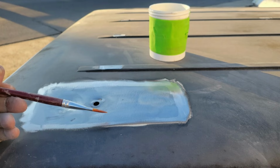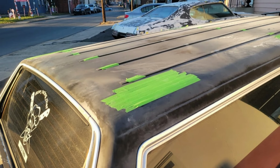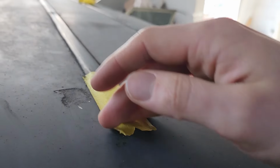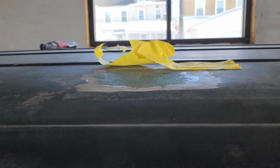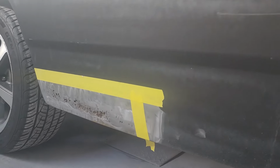Here the metal is getting treated to kill any rust and sealed with a low-tack water-resistant tape to set. Finishing up the metalwork here with a touch of Duraglass. Sanding down the paint to see just how bad the rust damage is. Thankfully, it's not too bad.